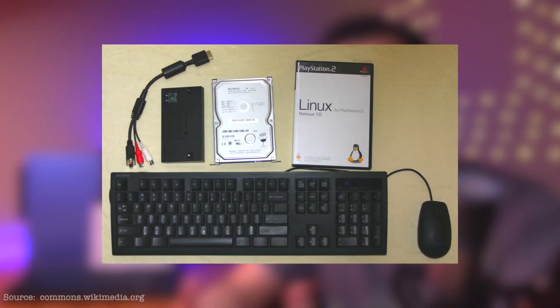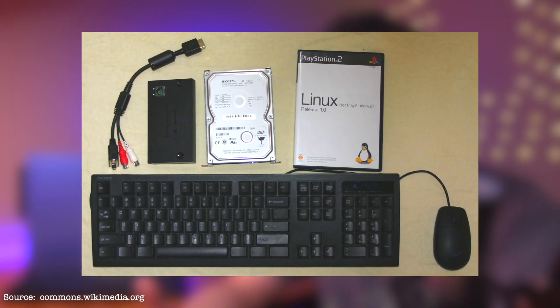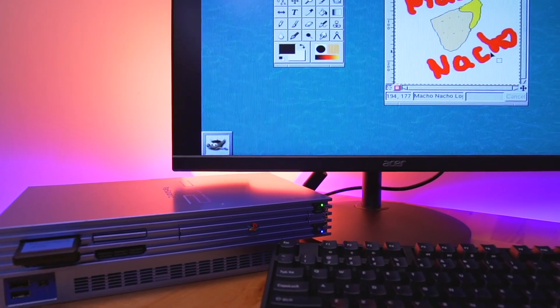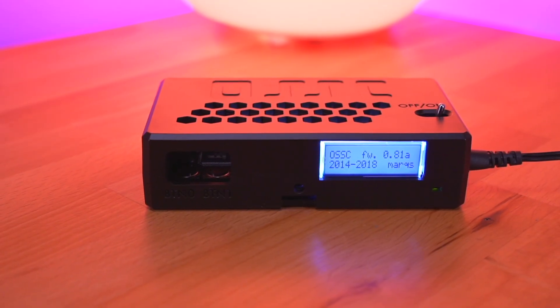20 years ago in 2002, just a couple years after the PS2's launch, Sony released a Linux kit for the console. In addition to the actual Linux software disks, the kit included a PS2-branded mouse, keyboard, a 40GB hard drive, the network adapter, and a special VGA cable to hook it up to a computer monitor. Interestingly enough, the Linux kit was the only official software that utilized this unique VGA cable. When using Linux on the PS2, you actually needed a monitor that accepted an RGB signal with sync on green — a requirement that wasn't ubiquitous on monitors of the day. Thankfully, I have a workaround for this, which I'll get into a bit later.